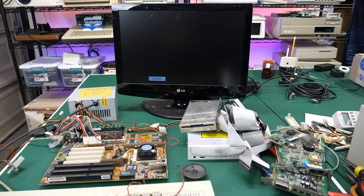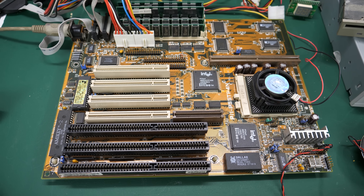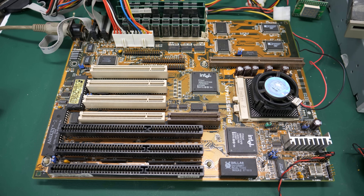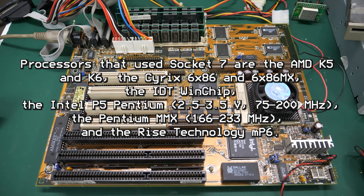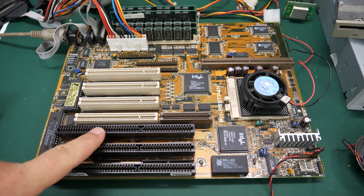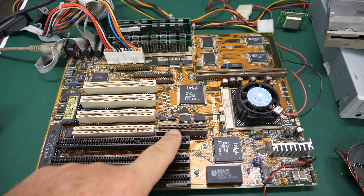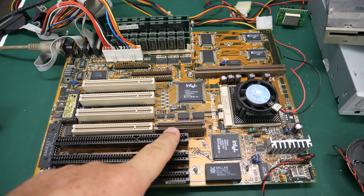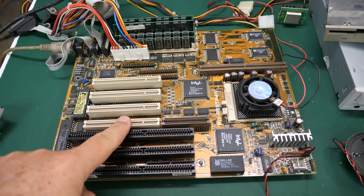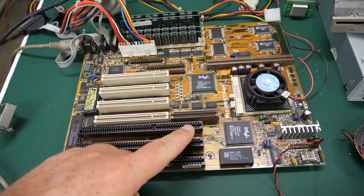Let's go over what I found when I took this apart. First, let's talk about the motherboard. The cool thing about this motherboard is it's a Socket 7 motherboard, which means it's good for early-ish Pentiums — Pentium 1, and I think after that Pentium 2 had the slot-type processor, so I think this is good for maybe 486s and Pentium-class CPUs. A correction while editing: I realized this is actually an ASUS MediaBus — a proprietary bus developed by ASUS to provide a cost-effective multimedia solution, and it only lasted a few years. I looked it up and I do have the manual for it, so that will definitely help.